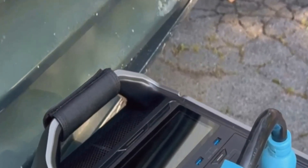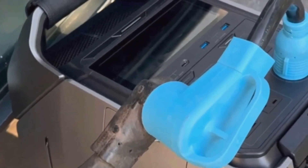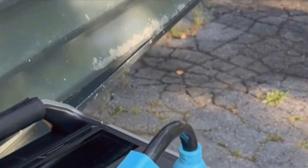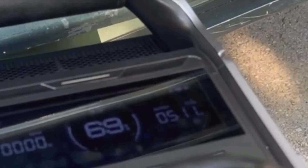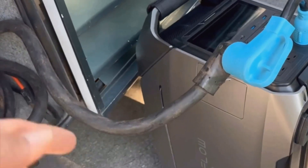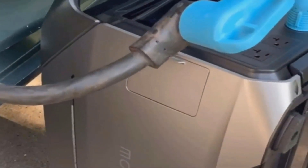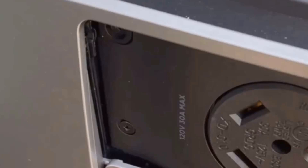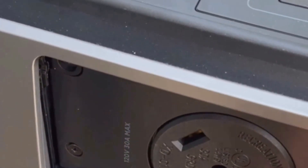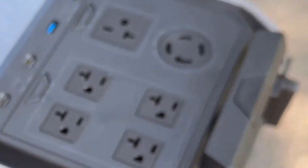From my experience, the Delta Pro 3 is the first portable power station I've used that feels truly do-it-all. I use it mainly for my 38-foot Class A RV, which has a 50-amp, 240-volt-style input. Using a dog-bone adapter, I hooked up the Delta Pro 3 straight to my RV's shore power input. It powered my RV without even breaking a sweat. The digital display showed 511 watts output while I was running both rooftop air conditioner fans and most of the lights.